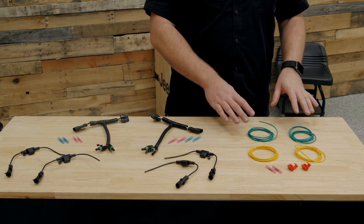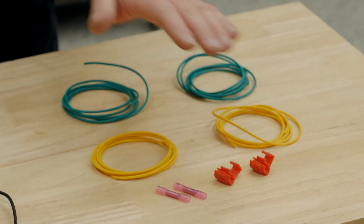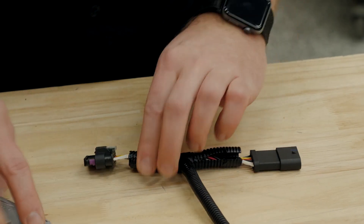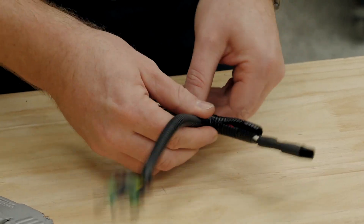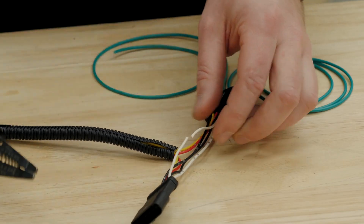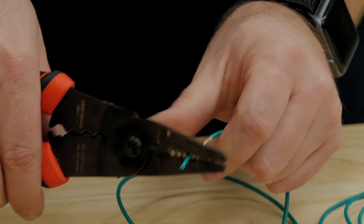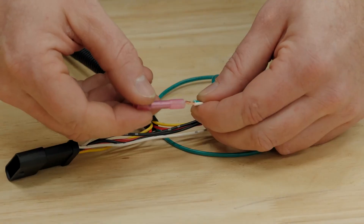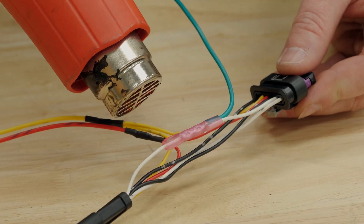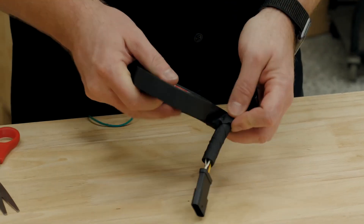I've got four lengths of 40-inch wire here in two different colors just to keep the wiring a bit more organized. To get started, we're going to cut away the wiring loom on one of our adapter harnesses, exposing the wires. With the wires exposed, we need to splice into the second white wire in the harness. Start by crimping the butt connector to one side of the white wire and add an additional wire into the opposite side — I'm going to be using the green wire for this. With the crimp completed, go ahead and heat-shrink the butt connector, then reinstall the wire loom and tape it up for a neat-looking install.